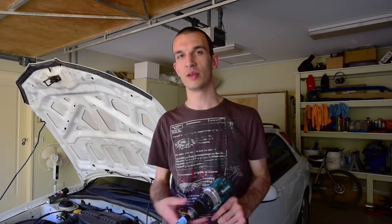One thing to note when installing HIDs: please don't install them unless you're using projector headlights, or the car has projector headlights as an OEM specification like this Subaru does. HIDs in reflectors cause a lot of glare, as the HID globe is actually offset differently to a standard halogen globe, meaning you're blinding a lot of other road users. I recommend running crystal visions or something similar if you've got a reflector — keep the HIDs to projector lenses.